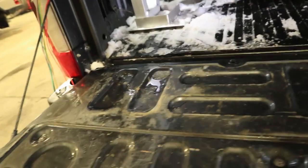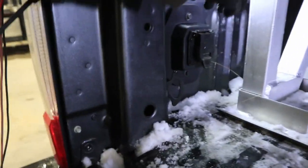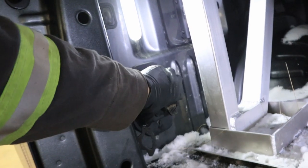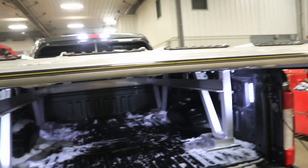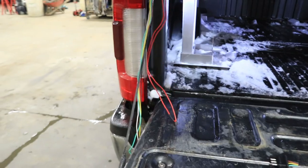Most sled decks come with your typical four-prong trailer plug. Now they have this bundle wire here — kind of like my last truck. Since I have the fifth wheel plug in the bed, that's what I want to put it to. We also have backup lamps, so I should be able to hook up this rear LED bar. It has left and right turn signal, brake light, running lamps, and a full white for backup — so I want to make sure that gets hooked up. Then there's something about this red wire for 12-volt constant, but there's a big manual that instructs you on how to hook that up.